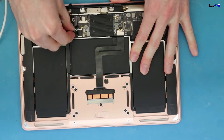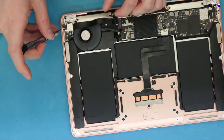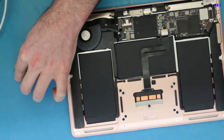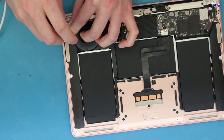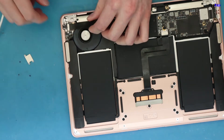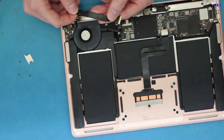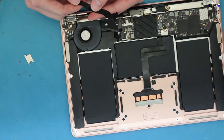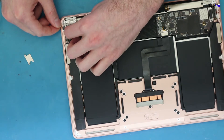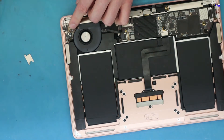So let's just take this out again — take out the power connection and undo the connection here. We're going to go see if there's anything else. We did clean it already, but sometimes even though it's been cleaned, that's not going to be enough because obviously the liquid damage could be too impactful. We do sell this cable on our store — the link should be in the description below. So let's undo it. The power button cable connection is right here. When this is being undone, you just want to be always very careful — just take that out, it's a loose cable here.